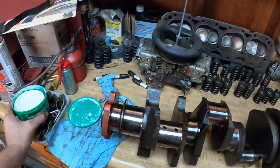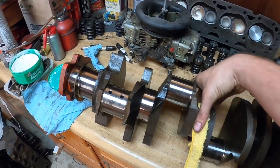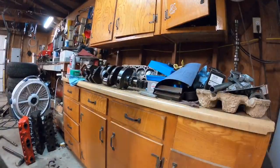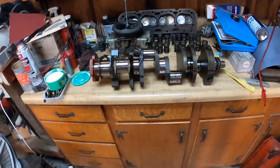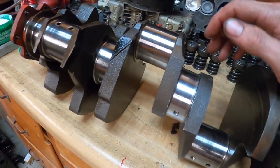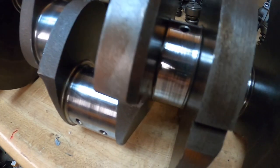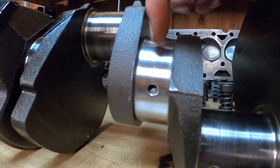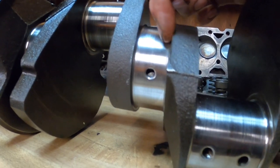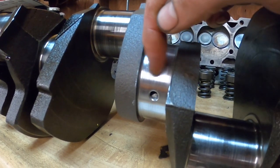What I'm about to do is use some polish — some Turtle Wax. I'm going to take a little bit of a microfiber cloth, put the polish all over it, and then do the same kind of deal with the sandpaper piece I cut off. Here's what it looks like after the polish is done. It looks pretty dang good compared to what it used to look like with all those big old grooves. Compared to that one right there that hasn't even been touched yet, this looks night and day different. I pretty much got nothing to grip onto now with my fingernail.